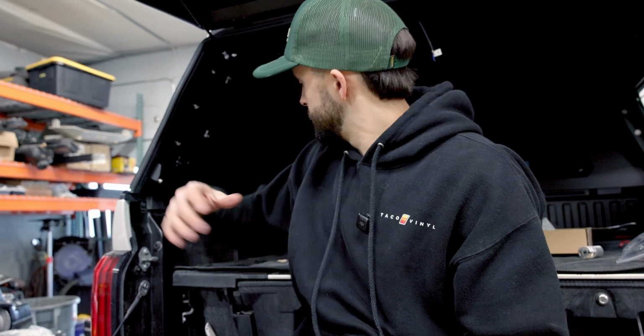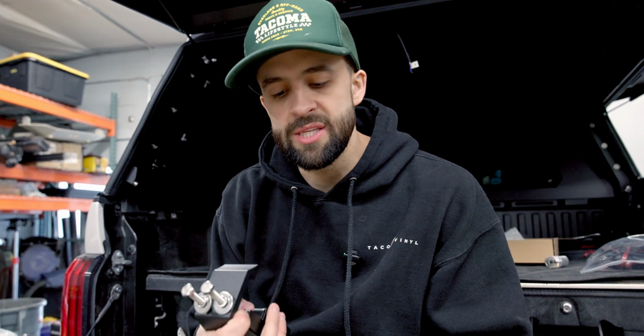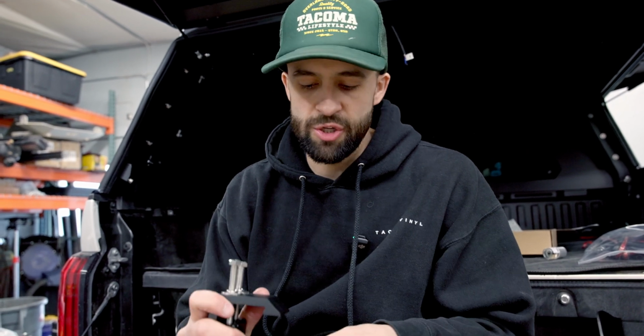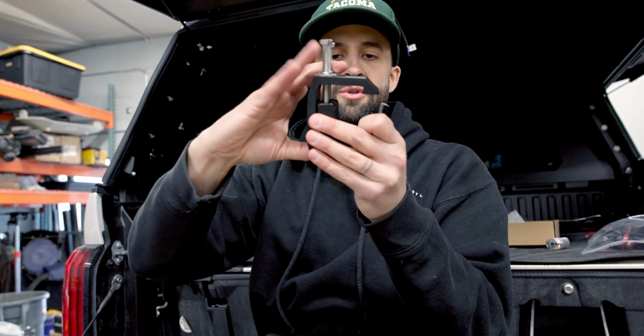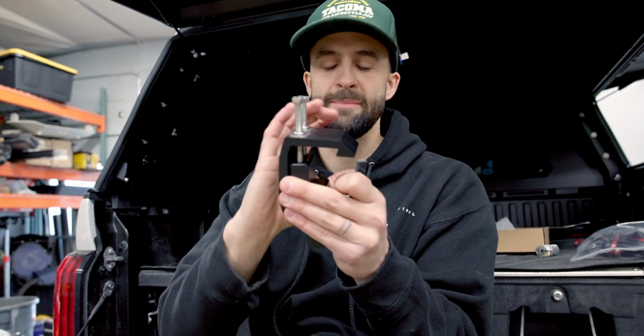And what I would do is I would basically get it clamped down, see where it clamps, then unrelease it, put this down, and then clamp on top of it. It's going to rough up the powder coat just enough to where this is going to adhere a little bit better. And it'll give you a good footprint of exactly where to put this, because you don't want to put it down and then have it slide off, because these things do shift a little bit as they become tighter due to just warping as just like geometry of this whole clamp system.